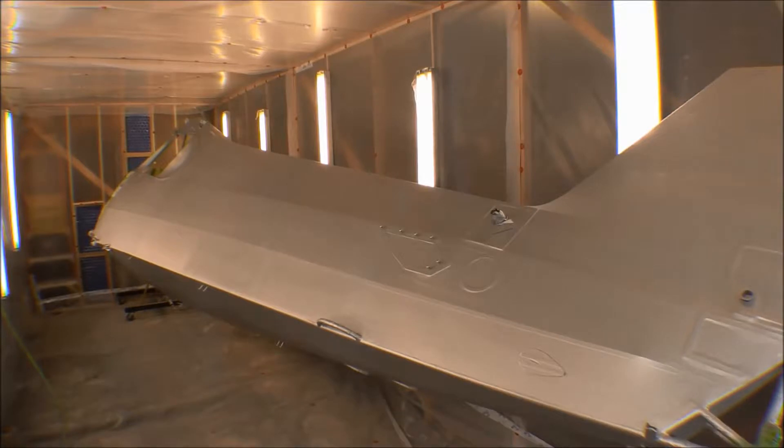I came over and just touched it lightly with sandpaper - it's almost perfect. There were a couple little knobs and a couple little frayed pieces of string but really nothing major. I went over it real lightly with the sandpaper just to make sure, then took a damp cloth and wiped it all down to get the sanding dust off. I'll let this dry and go over it with acrylic cleaner, then spray a coat of white polytone - it uses the same solvents as the poly brush and poly spray so it'll bond right into it.